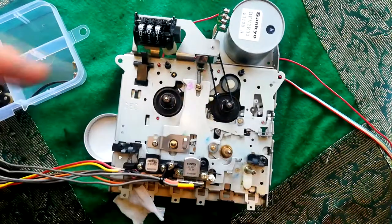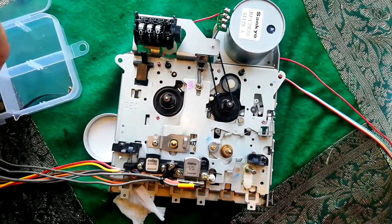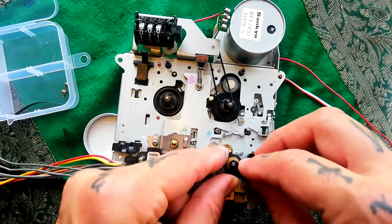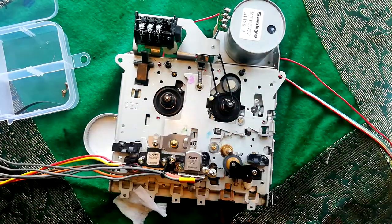Because it's got a bearing underneath, it's still going to roll. The spring that goes on there — I haven't actually put the pinch roller arm back on yet — but that's just like a little bit of suspension for it coming up here, so it's tight against the capstan and the tape can be pulled through without putting unnecessary stress on the tape.